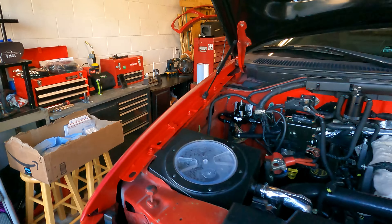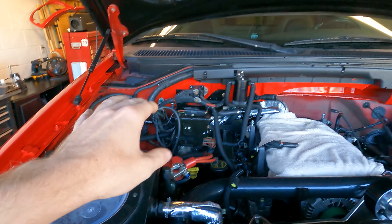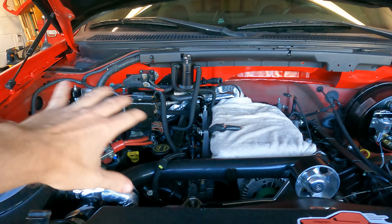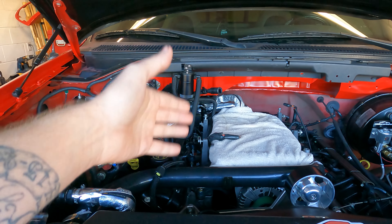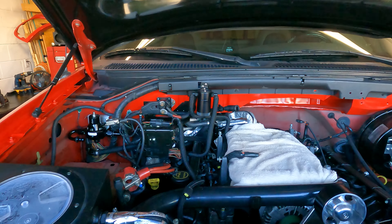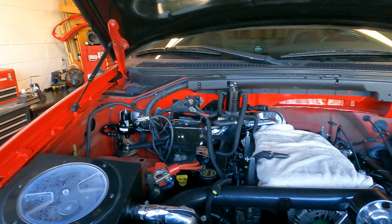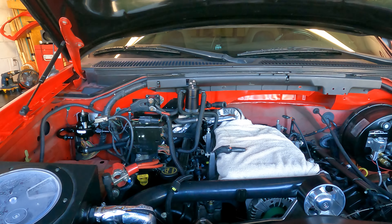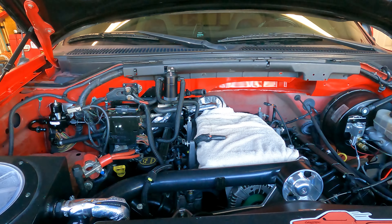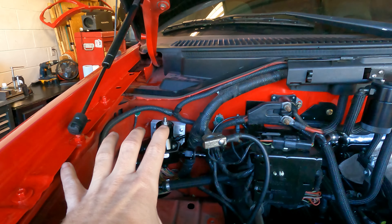I went ahead and mounted my regulator. I like it kind of remote and hidden over here. Generally, you do want to mount your regulator as close as possible to the rails — it helps regulate pressure better with the injectors firing. The further away the regulator, the less ideally it can regulate pressure. But I talked to a buddy of mine who did the exact same setup and he has zero issues. I think that's more of a theory than actual practice. You can do remote regulators and it works just fine. Plus, I'm not going to be pushing this thing to the absolute edge, so we should be good.